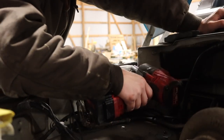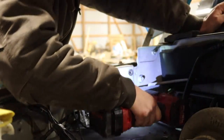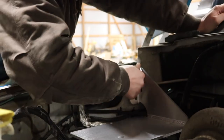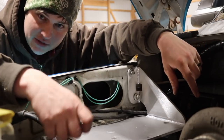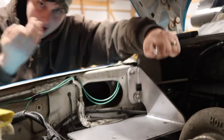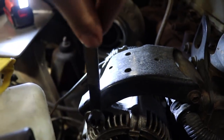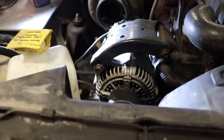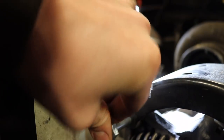Just like that, it's out. Now the rest of the process is pretty simple. You've got two more 13 millimeter bolts — fender bolts. Just going to remove those. Take your new battery tray, a nice shiny Pusher one. Now you do actually reuse the two fender bolts that you pull out for this battery tray, but you've also got two new small bolts that Pusher gives you that you feed in through this tray and then you fasten up through underneath. The next step is going to be removing this bolt on your alternator. It's going to be a little bit tough to crack loose at first, but it will come out. Use some penetrating oil on the backside to get on those threads and it will back out. And then you're going to take this new bolt that Pusher sends you, feed it right on through there, and thread it in.